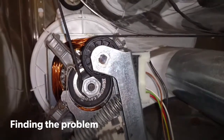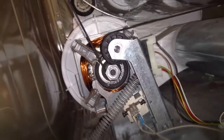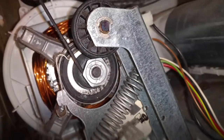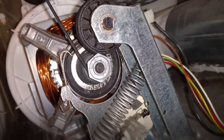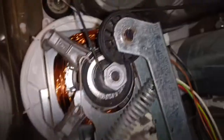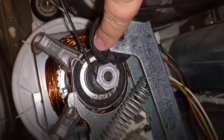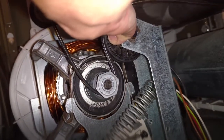Now that I've had a look at this, I think I found the issue. After removing the top and back of the washer, I'm looking at the motor and where the tensioner and the shaft from the motor are — they actually physically touch right there. If I manually turn the drum, those two pieces are touching. That's where the vibration is coming from: that round piece touching that hexagonal piece. Normally the tensioner should be a little bit removed from this unit. I need to figure out what to do next because I'm not sure if the belt's too loose or what.